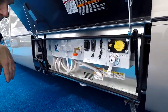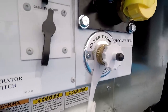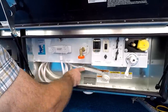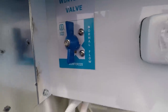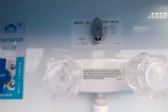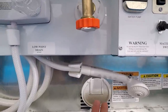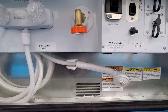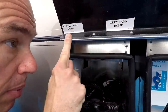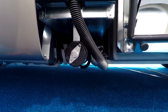This compartment takes some explanation — a lot of stuff in here. Starting upper right: a yellow propane connection and bleeder valve, below that a connection for the black tank flush, cable and satellite hookups, a switch for the macerator, propane shutoff, and a switch for the water pump — which you need for the exterior shower, hot and cold, so you don't have to go inside to turn it on. There's also a winterization valve and a selector for the single water hookup: you can either fill the tank or use city water directly.